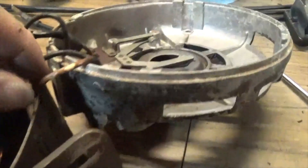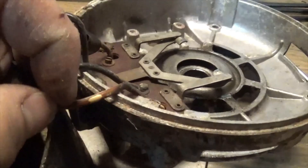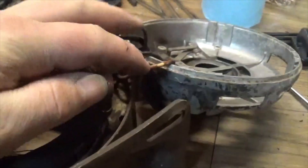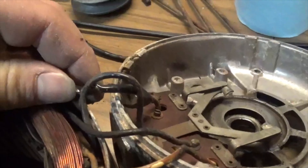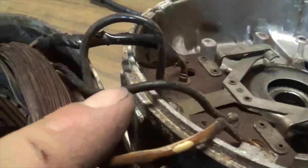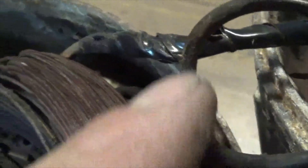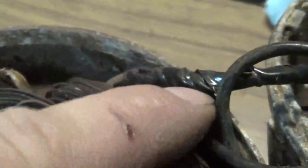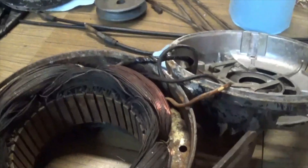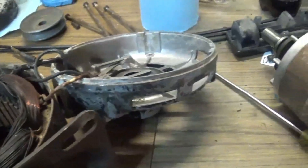It looks like there's some stuff dripped on this wire here - I bet you that was that epoxy dripping off onto that wire. We notice this one over here is taped, and you can actually see this wire was touching up against the run winding and it was starting to get pretty warm. That's probably what happened here - this wire was probably just starting to show some of its strands. The run windings got pretty darn warm.